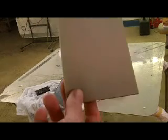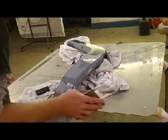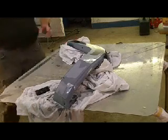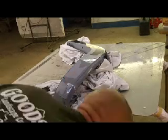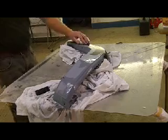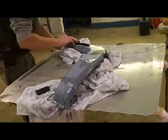And this is what I'm talking about right here, one of these guys. This is 3M fine. This may not be 600. This might be 320-400. We'll test a little spot first to see what kind of scratch it puts in it. Yeah, that's not the one I want. And that's the only one I have, so I guess we're doomed to using the hand block, which is okay. Actually, I could get a red Scotch-Brite, which I do have, to finish those spots up. That's too coarse.